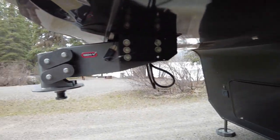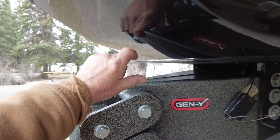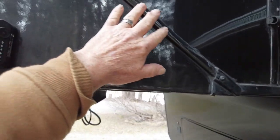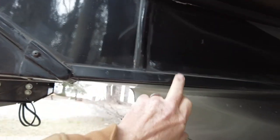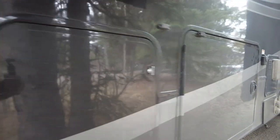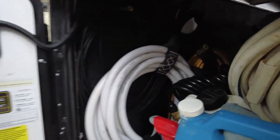People ask what else to look for. Obviously, if the hitch is rotating up when you put it on the truck, or this gap is changing when you're hitting bumps going down the road, you might have concern for some frame flex. Another thing to look at is this seal — if the seal is busted, you see excess movement on this expansion joint. You can see chafing marks where that sealant has failed. For mine, all that was happening. Another thing people ask about was the screws up here — you can see the existing screws and the screws that I added to try to tighten this gap up.